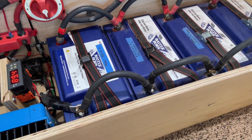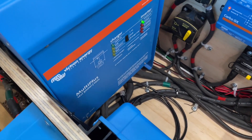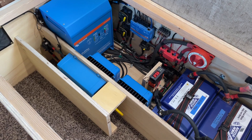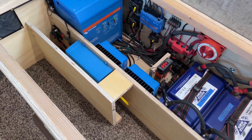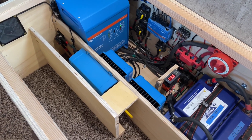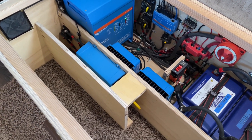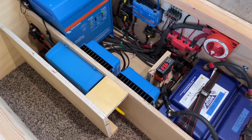On top of that, we added a second inverter. We have a Victron Multiplus 3000, which is an inverter-charger — it's an amazing inverter and powers pretty much everything we need here in our rig, including appliances like an air fryer, coffee maker, microwave, toaster oven, etc. But it does use a lot of power at idle when it's just sitting there not doing much. Because we're using constant loads such as Starlink internet, which takes about 50 watts on average, we're using more power than we really need.